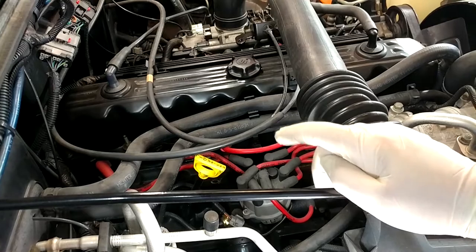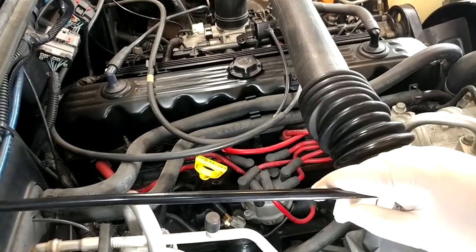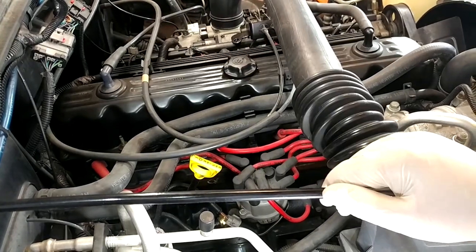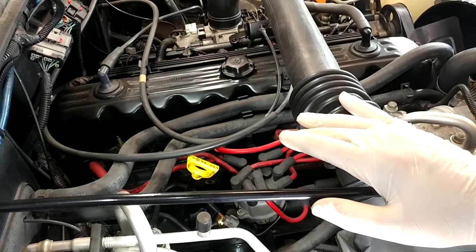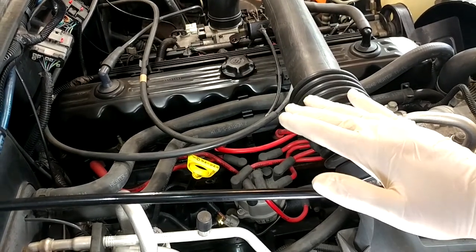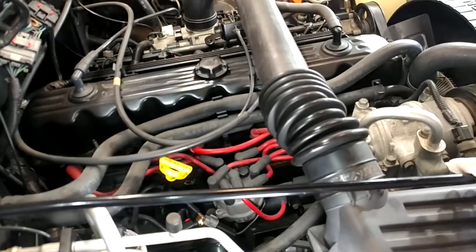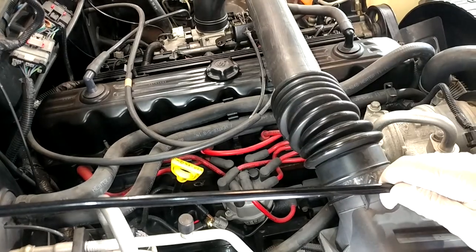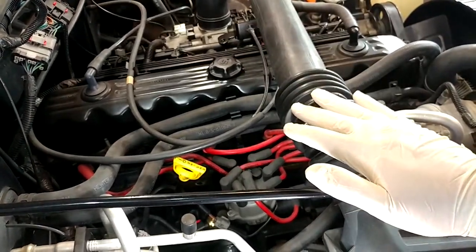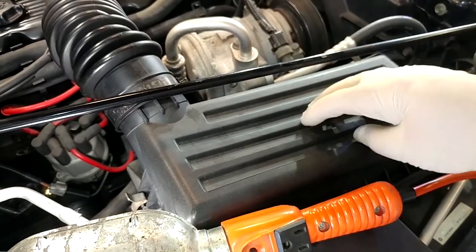Since those are mechanical parts that actually whirl around and spark inside, they wear out over time. This guy's actually running just fine, but the cap and rotor on it have been on it for about 10 years and probably about 50,000 miles. Those spark plug wires have been on it for about 70,000 miles, and since 2005 the plugs are probably also from around 2005. So it's just time to get all this stuff out of there and get it freshened up. Normally a tune-up would include any serviceable filters too — we just did an oil change not too long ago and I've also checked the air filter recently, but we'll take a look at it again just to be sure.